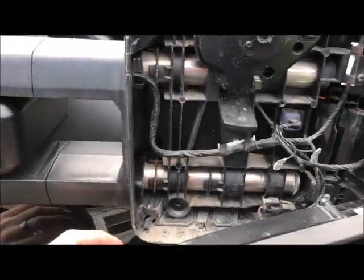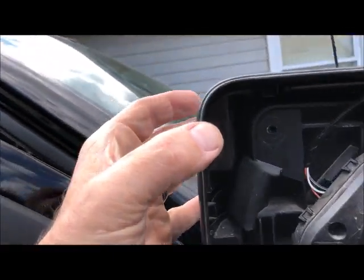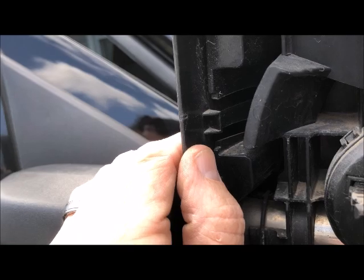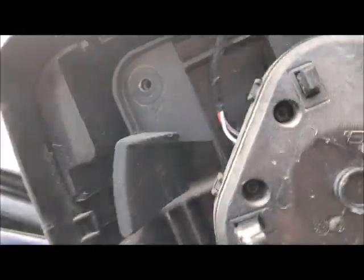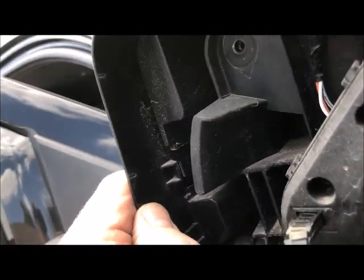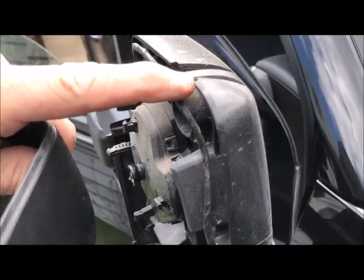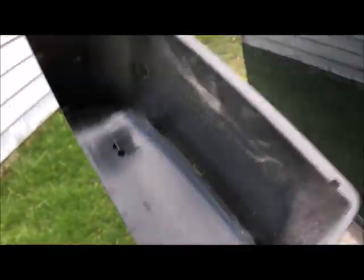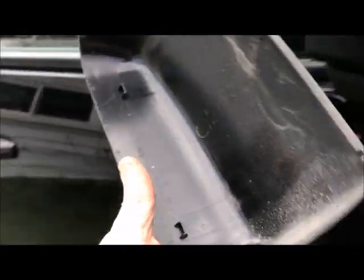This is the mirror in all its glory. What's happening is there's a tab here — just take this, put it up past that tab and push it to the other side. Do the same thing on the other side. These are the tabs at the top right here — they're fine, but they're not holding onto these tabs. So when you put this all back in, that finger is pushing on this tab and it's not enough. So what I did is I added a piece of foam behind here on each one of those to take up the slack.